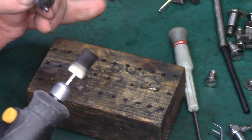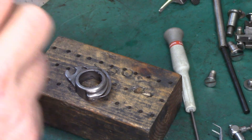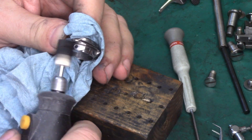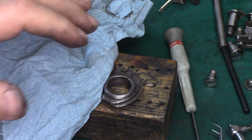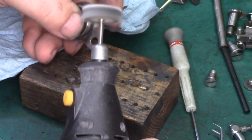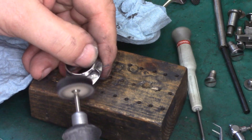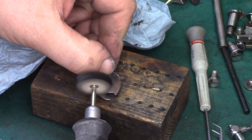Polish, polish, polish — that's the story of my life. We'll move over and take a piece of blue paper towel to wipe off some buffing dirt. We can use the paper towel to hold this too, because it's getting bloody hot at this point and it'll help stabilize it. I've switched over to a bigger hard felt wheel and I'm going around doing more polishing on the body itself — you'll see it's starting to come up nice and shiny.